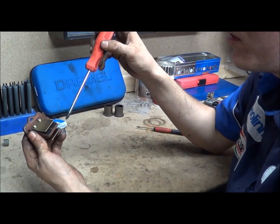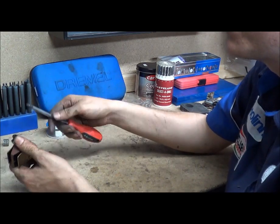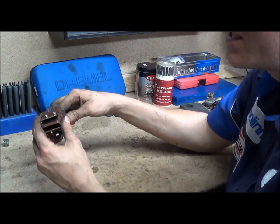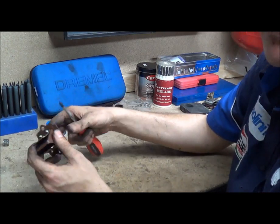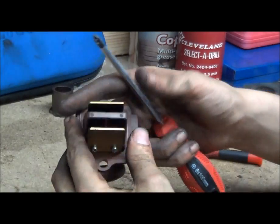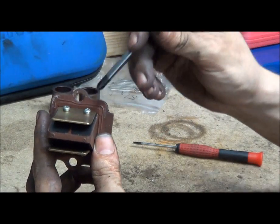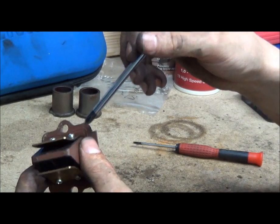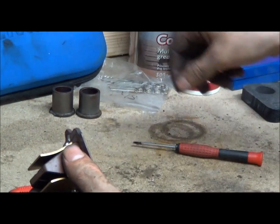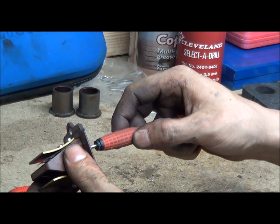You have your petals — your reeds. I call them petals, most people say no, they're reeds. Your reeds in here flap one way, and then you have your retainer on top. Your retainer is basically there so your reeds don't bend too far.